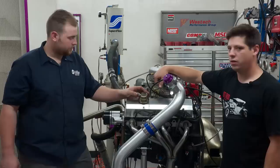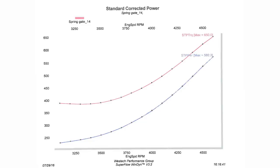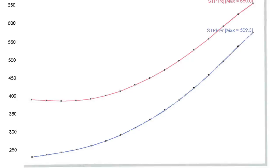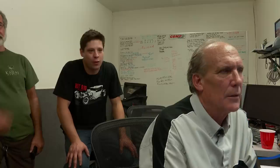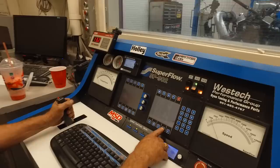We've got Steve's expertise on the dyno cell computer to make sure things are the right temperature. That's too much boost — Steve cut it off at 13 psi and it was still building. In 100 rpm it went from 12 pounds to 13 and a half, and we're only at 4,500 rpm. Someone who gets this kit that doesn't know anything about how cars work and figures a way to bolt it on — they've got 600 pound-feet of torque, 13 pounds of boost, and they can impress their friends at the drive.